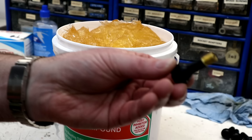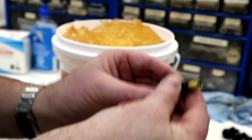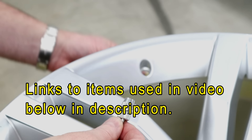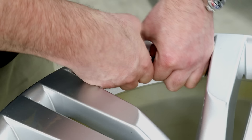If your valve stems don't come pre-lubed, put on a little tire lube of your choice to slide them in — it never hurts. To pull the valve stem through, I'm going to use one of these little valve stem tools. Just put the valve stem in through the back, thread the tool on, and pull it up. You'll hear it pop when it's in place.